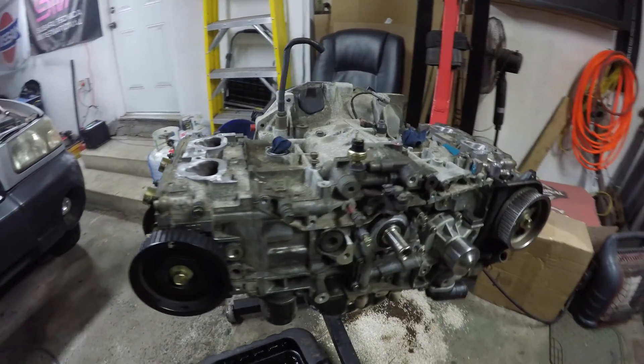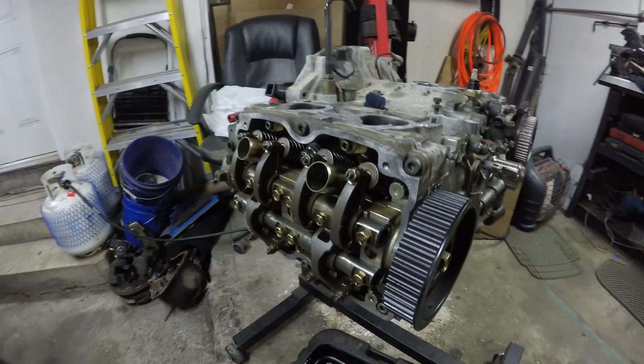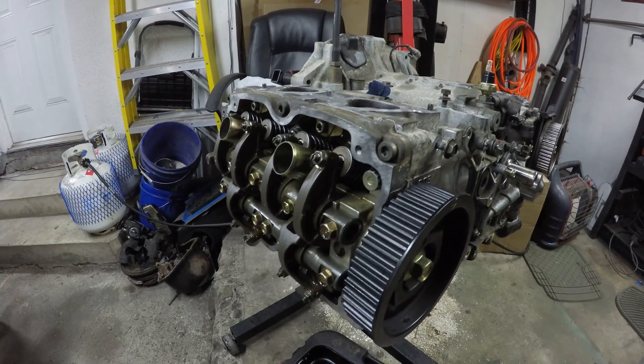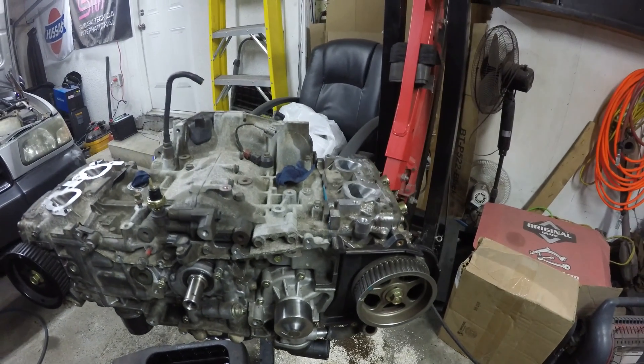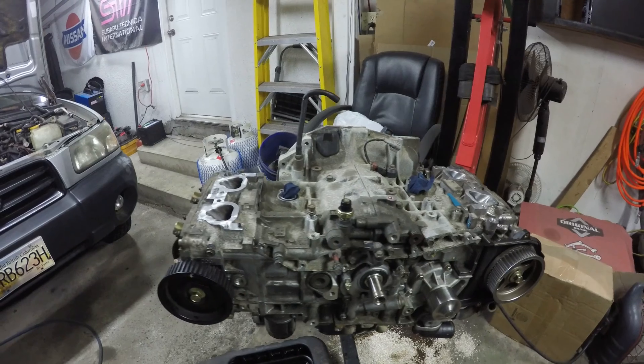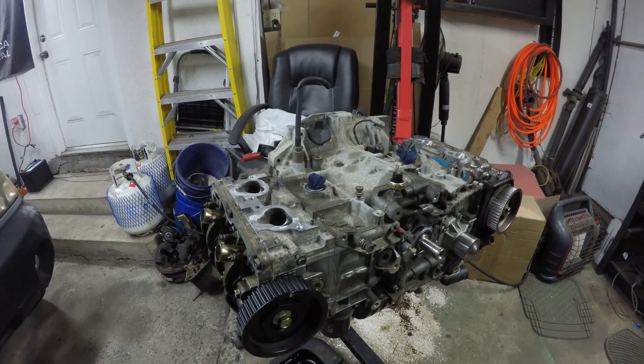There is the long block all back together — both sides have been torqued up. Something I wanted to note: I did reuse those head bolts. A lot of people think torque-to-yield bolts are not reusable, but if you oil those washers and threads you can reuse them no problem. I'm going to leave the timing belt and adjusting the valves for the next episode. I have a lot of cleaning and painting to do — get that intake manifold and those brackets all cleaned up, and then it'll all go back together. I've been taking my time and filming as much as I can, including time lapses, so you can see how much work is involved. If you like this video, give it a thumbs up, and if you're new here, please consider hitting that subscribe button and leaving your questions and comments below.